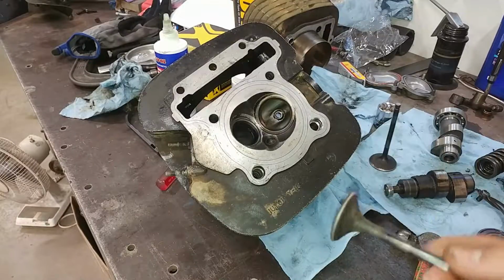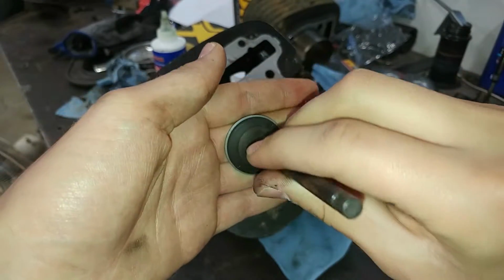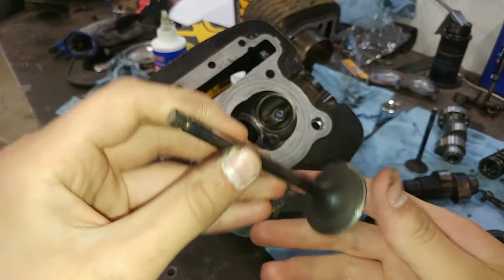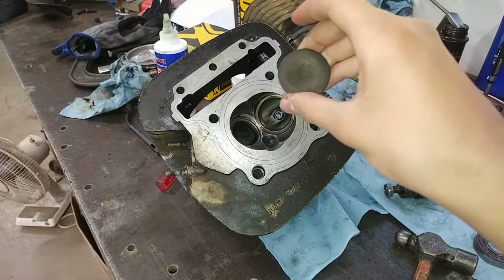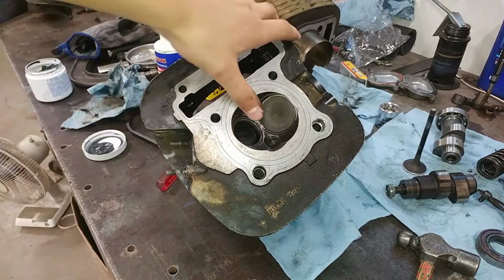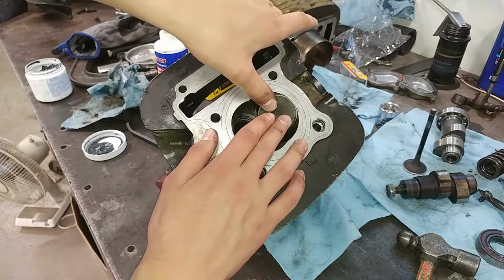Okay guys, I just tried lapping the exhaust valve here, and it actually wasn't too bad. I don't even have a suction cup tool to spin this, and I've got a pretty good valve seat on there. So now I'll do the intake valve. Just dabbing a little bit of the compound around the edge, pushing it in there, and just spinning it around a whole bunch until it sounds good to me. Okay, we got some compound on there and got it shoved in here. Now we're just going to spin it a bunch until the sound changes and I feel like it's gotten smooth.